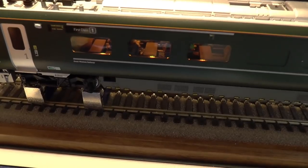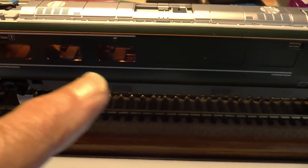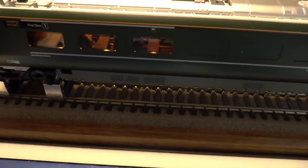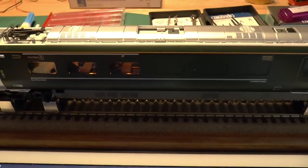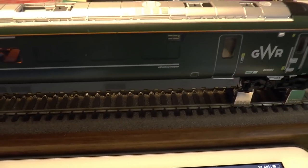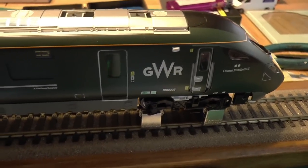And I took the chassis apart as regards all the seating area, which obviously stays there when you take the body shell off. I had to take all that off and reposition that drive shaft going through here. And once I did that, I gave it a test, and sure enough, no click. So listen to this. All we can hear is the motor turning. No clickety click. Perfect.